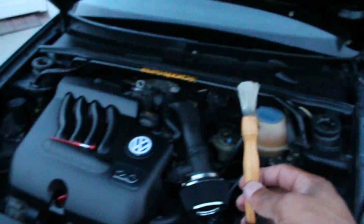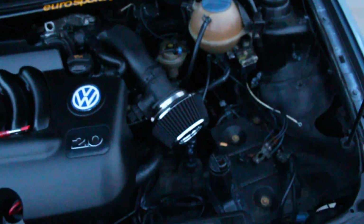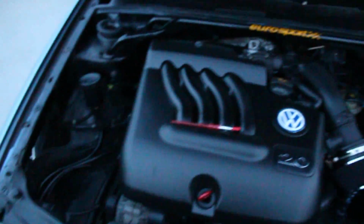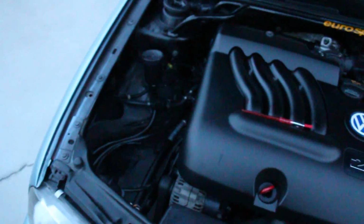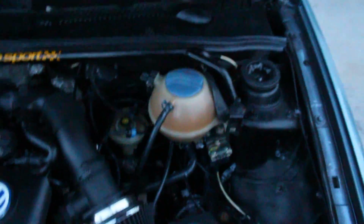So all of these battery ones down through there, everything down there. Honestly, if you're gonna do this, get a brush. It makes going through and hitting all of these spots so easy to do. So after you hit everything you wanna hit, you're gonna let it sit for probably 10, 15 minutes, let it really soak into the rubber or the plastic, then go back through with a microfiber or your paper towel, whatever you have, wipe off the excess and you should be good to go. But it looks so much cleaner already.